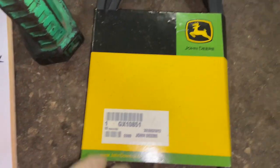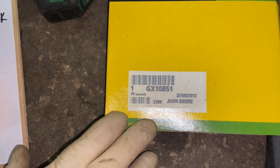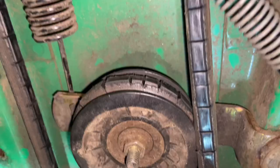We also have a flashlight. I think we have the correct belt — I looked it up. Like I tell everybody, check your belt against your new belt before you put it on. The first thing we have to do is take off this belt because it has many, many cracks. This is not a cog belt when it's brand new, and it should be replaced.